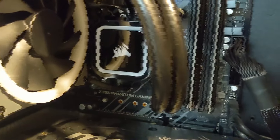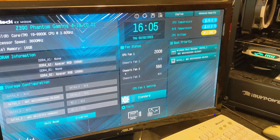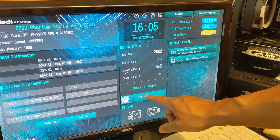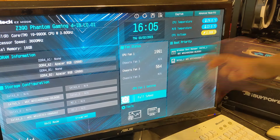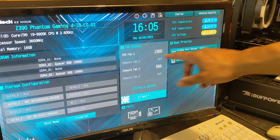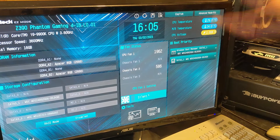That feels nice. Let's give it the first boot. Let's jump right into the BIOS first and see what we get. That is definitely better - look at this. Finally at idle we're running at 29 degrees Celsius. Originally in the BIOS they actually had the CPU fan setting on full blast, which they probably had to do due to all the heat problems. Now the computer is much more quiet - I could probably leave it at silent. The fan speed is about half of what the other one was. Running at 29 now as opposed to 50 and climbing.